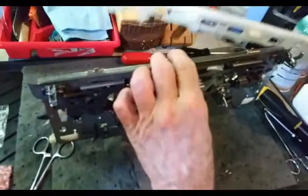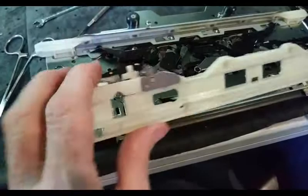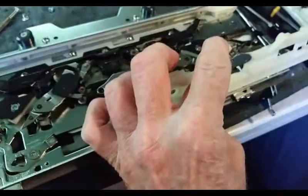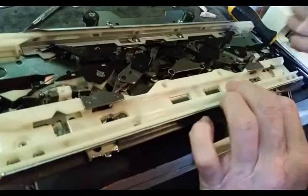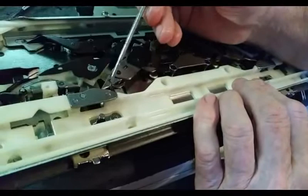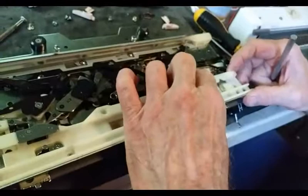With the cover off, you'll see them in these two areas right here. Here's the maneuverable trick: getting these two started in — this cross piece and that cross piece. Now, this is in position, but the end of your stitch size selector will go under it. You can see it — I just moved that one. It normally stops against this metal plate, so it's going to try and slip under the edge of it every time it comes up. You've got to get it out of the way to put this back into position.